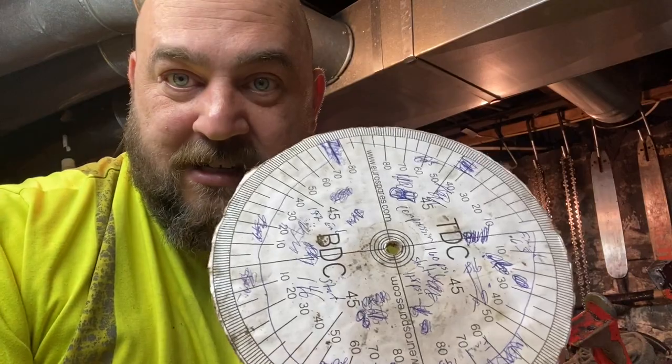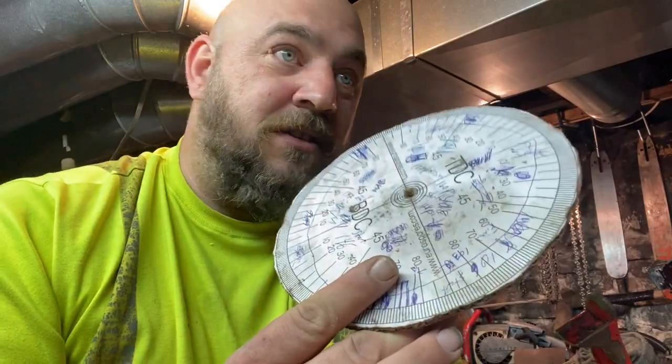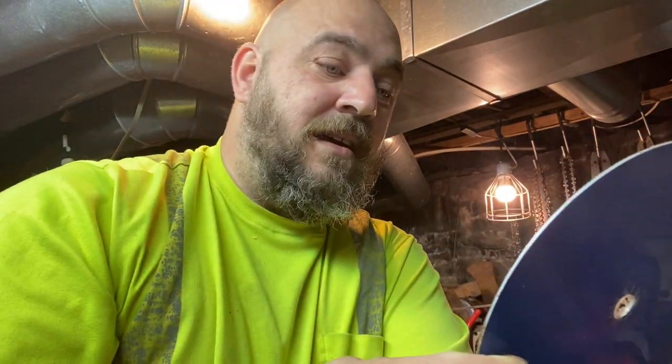If you don't own a degree wheel, you don't need to buy one. You can print them. The nice thing about printing them is you can write on them — print it out on a piece of paper, glue it to a piece of cardboard, and you've got a degree wheel. It costs you nothing. I actually used these for a long time because I like how I can write on them, but I've recently switched to a purchased degree wheel. So you have an option there. If you don't have one, just print one — start out on the printed ones, they work just fine. You don't need to buy one right now until you decide if you want to continue doing this more and more.